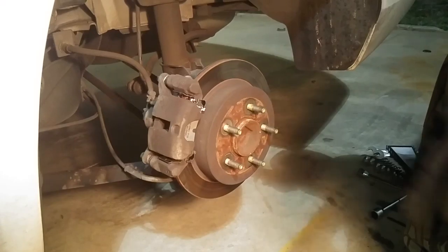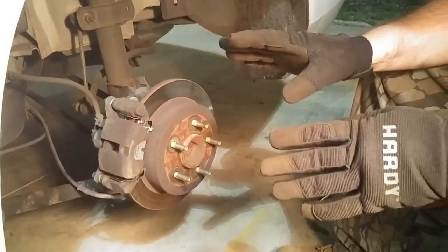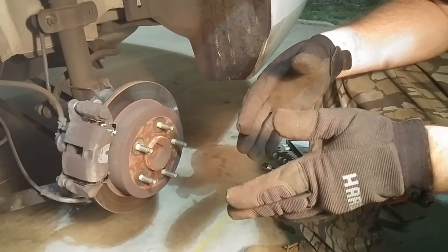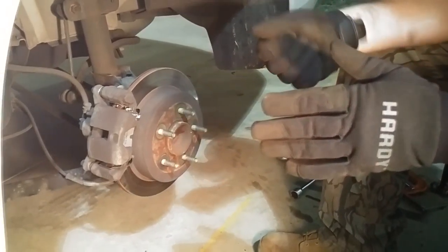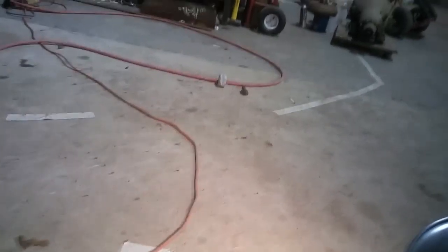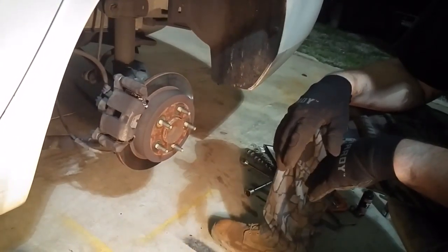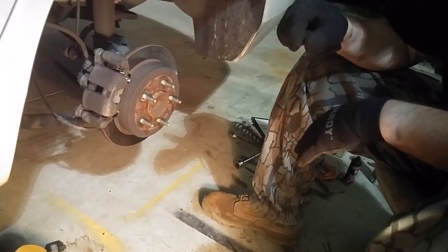All right, once you're done, after you put the tire back on, you've done all four tires, you're going to go inside the car, start it up, and if you need to add brake fluid to the reservoir, go ahead and top it off. You're going to pump your brakes about a dozen times, just push them to the floor, let them go, push them to the floor, let them go. Then check your fluid again, top it off,